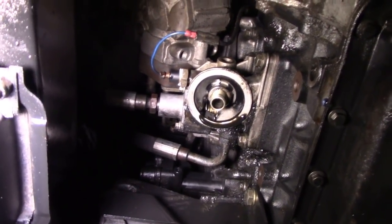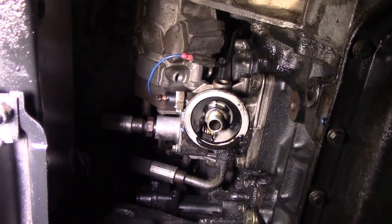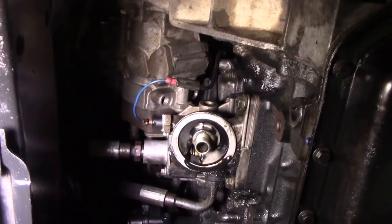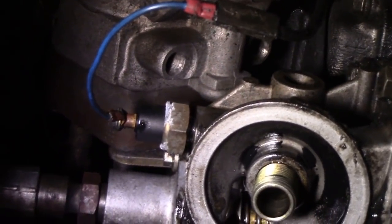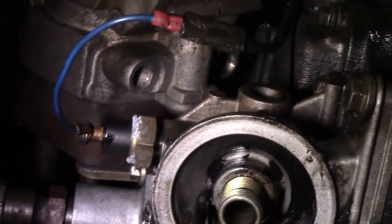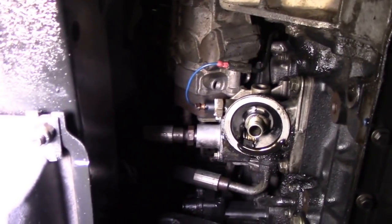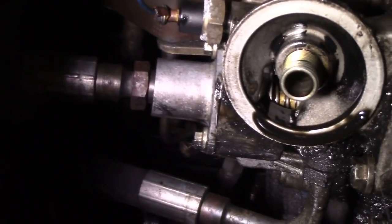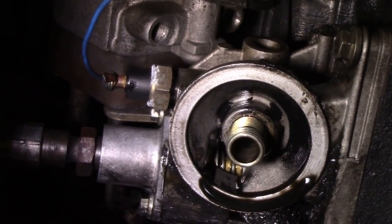Now at the same time, I want to change the oil pressure switch because that's not the right one. You can see the original connector there has had a jump lead put onto it, because that's a screw on top one. So I've got some OEM switches which are good. So all we've got to do is take off, I'm zooming because I can't reach, that nut there, which is 7/8 I do believe, and the two 10mm headed bolts, and then we'll do the rest on the bench, and I've got something important to tell you.